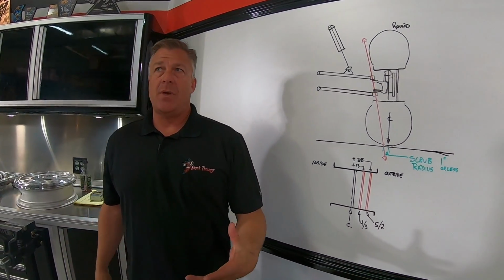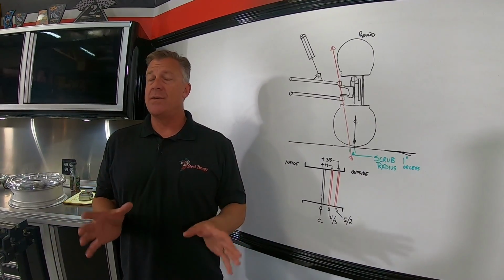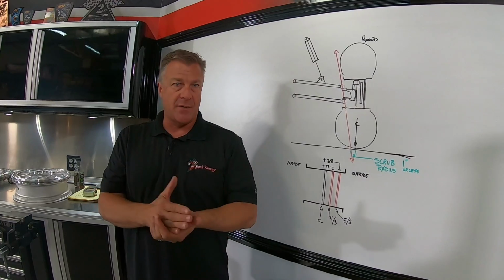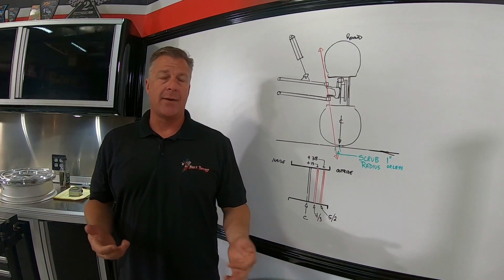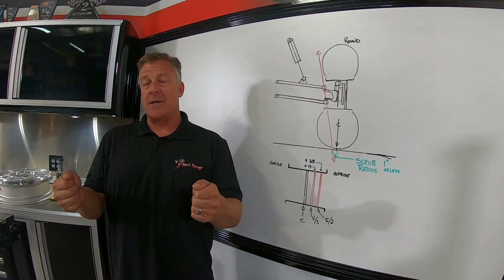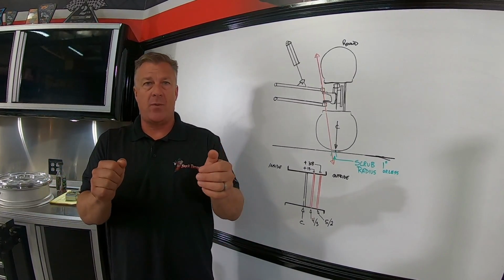It does. Well, let me give you a couple of places where this works and where this doesn't. Everything I'm talking about for feedback is strictly related to the steering, which is the front of the car. You can do any wheel offset you want on the back, and it's not going to give you any steering feedback, good or bad. But the main place where the wrong wheel offset is a problem is when you hit rocks, shelves, something sharp that's a snap in the wheel.